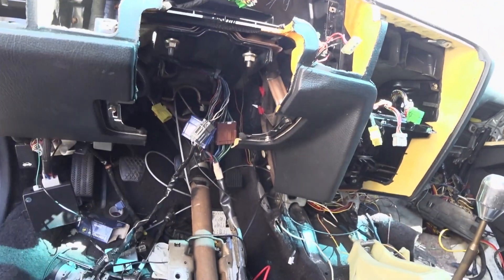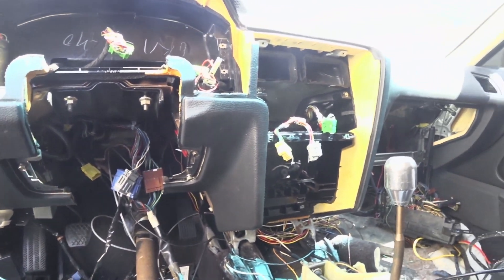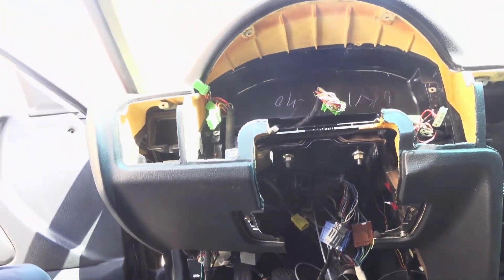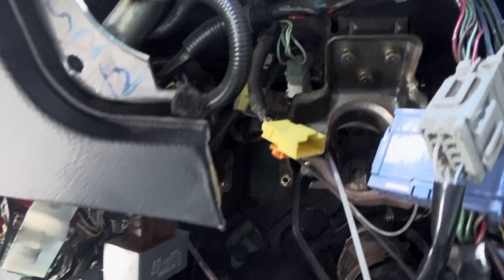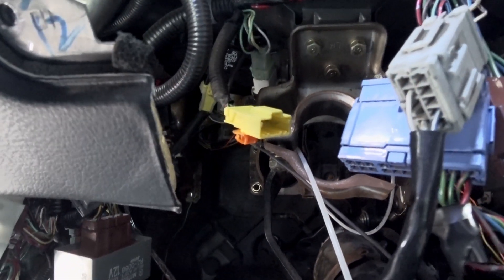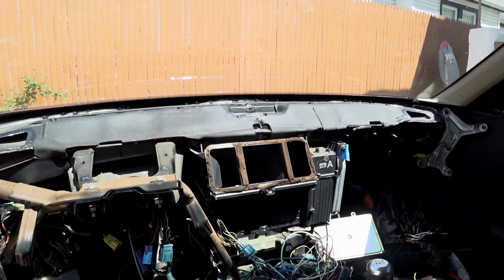The issue with this car is every time I try to start it, it will crank but there's no power going to the fuel pump or the main relay. I jumped it from right here and everything works, so I'm trying to figure out why. I checked the old videos and remembered I took out the clutch — I'm wondering if doing that damaged either the sensor or the connector.